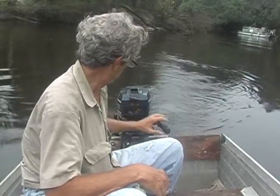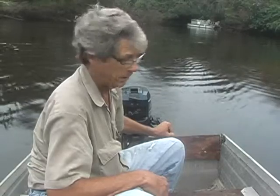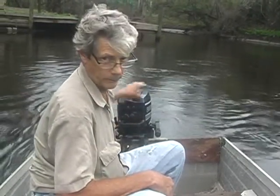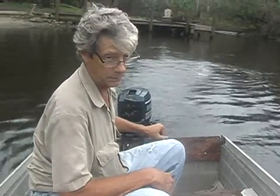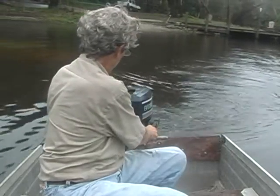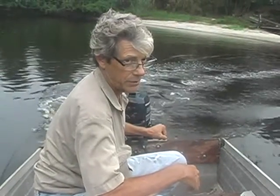It's a freshwater river, but it is tidal, it's affected by the tide. We'll hit that one more time, see if the blubber in mid-range is gone now. I just enriched it a little bit more. Okay. Sudden change didn't have quite as much of an effect on it. Ooh, no stumble. Gotta love that. And it didn't stall when I tried to pick it up. That's good. It was a skosh richer. No blubber in the mid-range. This is good.